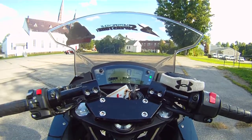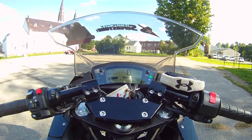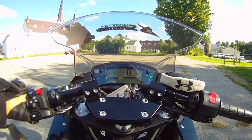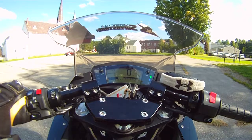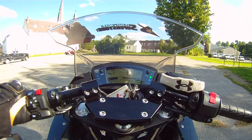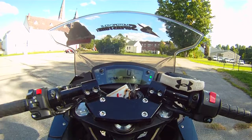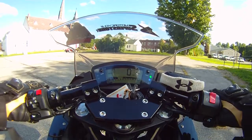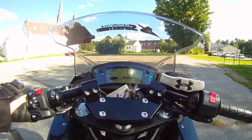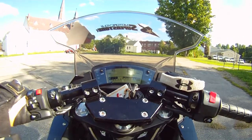Now if you were to pull in the clutch and pull it up, it's not the end of the world. You're probably going to stall the bike, but all that means is you're in second gear. I'll show you right now. So I'll pull this in, I'm clicking up. Actually, it won't even let me. Most bikes probably won't even let you do it. I didn't even know that. Learned something new. So I'm not even gonna put this hand on the bike right now, and I'm gonna show you. You pull in the clutch and you push down. You hear it click. So now you're in first gear.